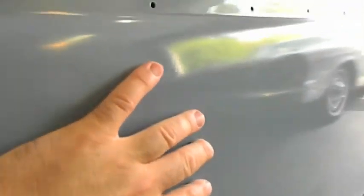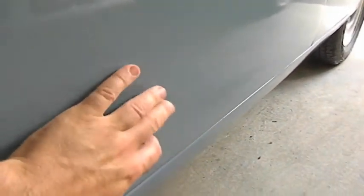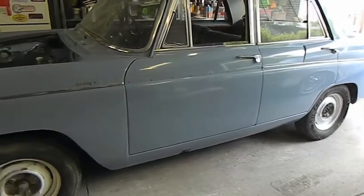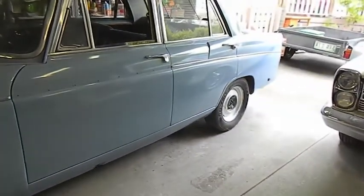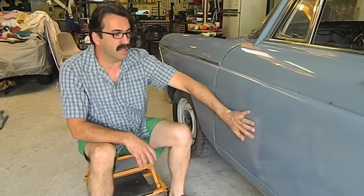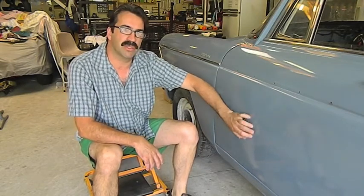That way I can get a good finish and a good result. The clear coat serves two purposes: it protects where it's been blended, and it's very hard, giving good protection against stone chipping. But in being hard it's harder to colour sand back. Once this is all buffed out and looking good, I should colour sand the rest — it's really, really peely original paint. I can do that later. The way it stands now, it's a great ten-foot car — actually a good six-foot car. But I want it a lot flatter and shiny. I've put down about four coats of clear, which is quite a lot, but in the colour sanding process I'm probably going to be rubbing out one to one-and-a-half coats to get it level, so it still offers good protection after we've finished.